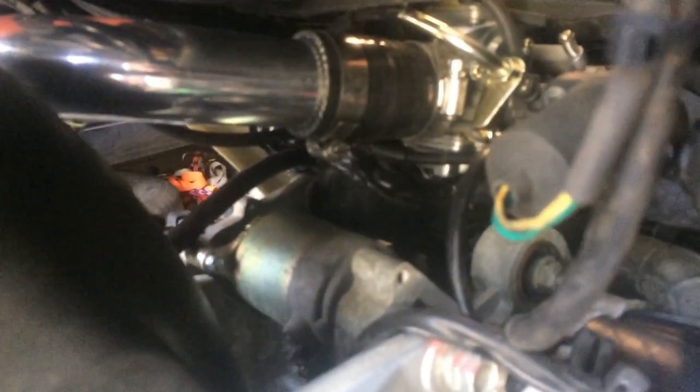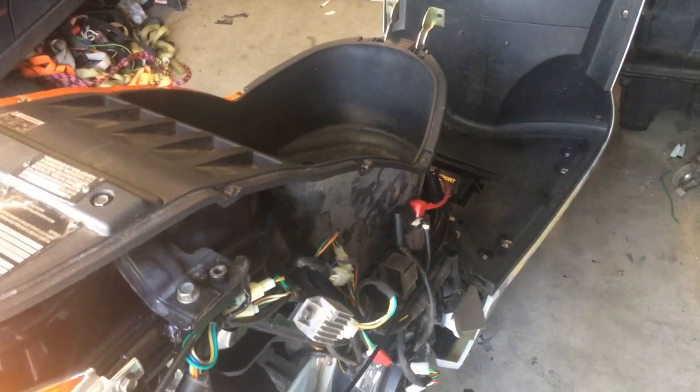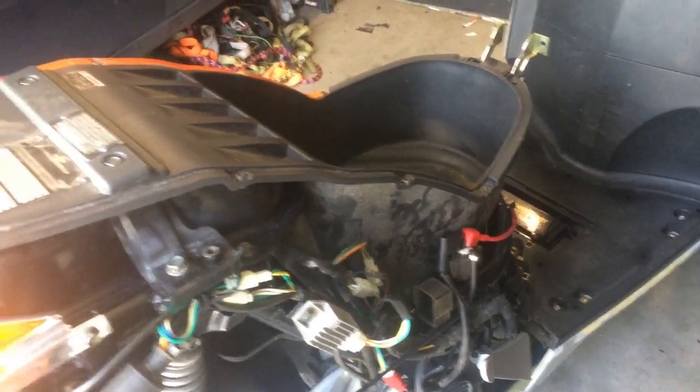The CDI is right here, and just below it is the coil — just two wires, pretty easy to access. I don't know if changing the coil will help much; new coils claim better spark, which matters more with higher compression. For a stock engine the stock coil should be adequate, but my coil boot is dried out and rotting, so since the new CDI order came with a new coil I might as well throw it on. Alright guys, thanks!